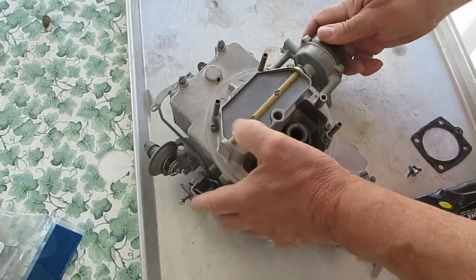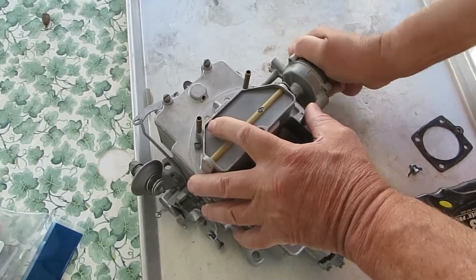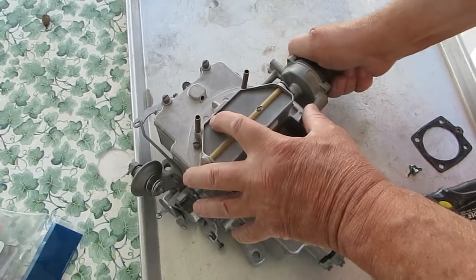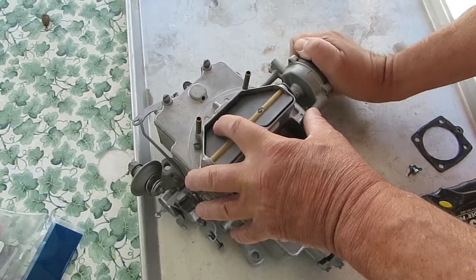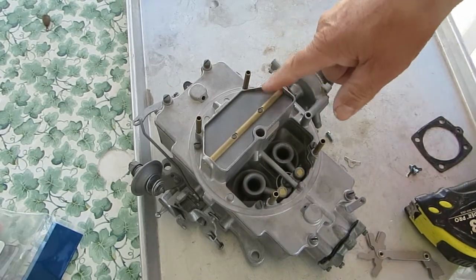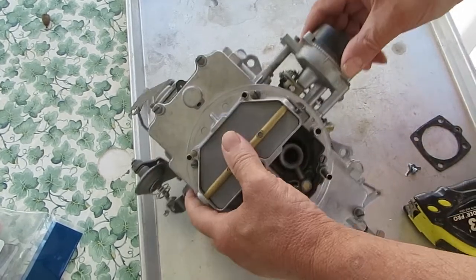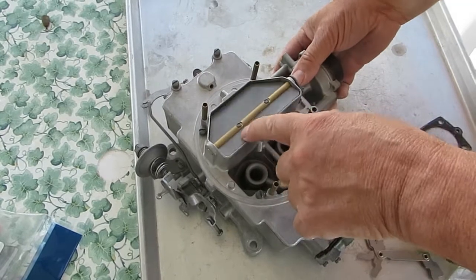Something was holding it open — there we go. I had it way too tight. Twist it counterclockwise and it just closes the choke like that with a little bit of pressure. You may have to do this two or three times — just until it closes the choke. Once it closes, do another eighth inch or so to get just a little bit of pressure. To test this: when it's cold it should be closed, and when it's heated up it'll be open all the way — that's how you make sure your thermostat is working. Don't blame the thermostat right away; it could be something wrong with your linkage or something installed wrong.